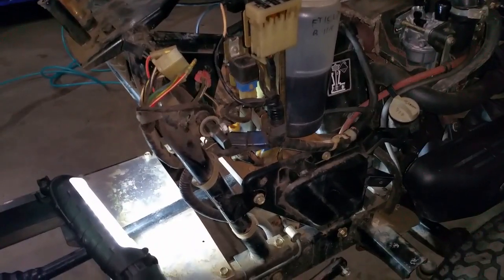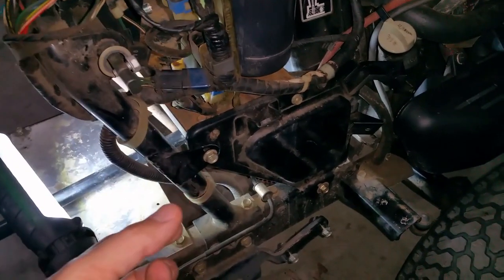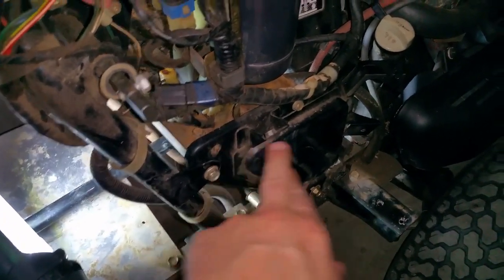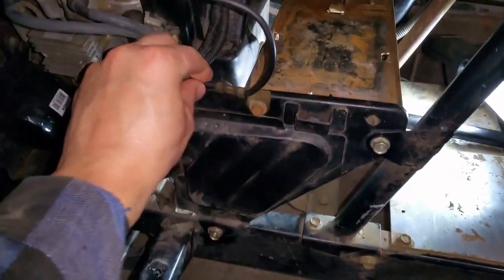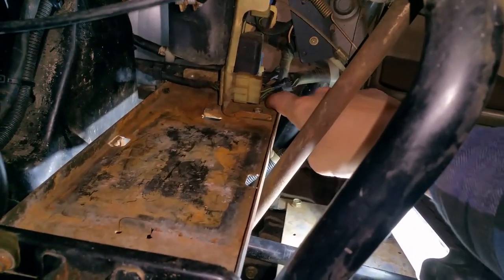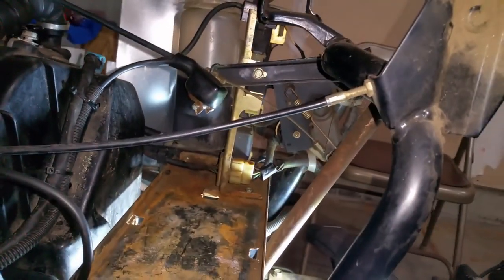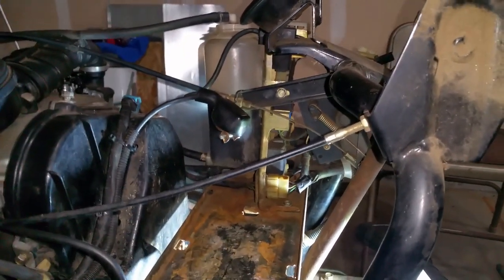With the battery tray, it's going to go back together like an erector set. Make sure you get everything in its relative position first with all the bolts loose, then tighten them down. It's going to be a little difficult to get it in between the two tube frame pieces — it'll be a tight fit because it's held in by a notch. Then you have one bolt here, one bolt on the other side, and a third right here for one of the wire holders. On the left side it's very much the same. There's a bolt here that holds the negative battery cable, and two 12mm bolts right here. Once you get that in place, tighten it all together. There are also two 10mm bolts right here — you'll have to remove this Molex connector to get to one. And up here there's another 10mm to remove the platform that holds all the electronics. You don't necessarily have to take that out; just loosen it so you can maneuver the battery tray into position.